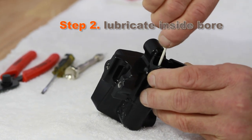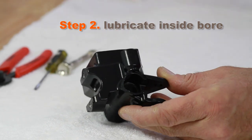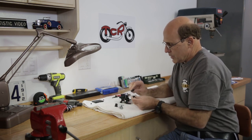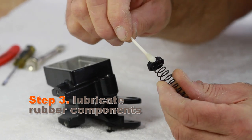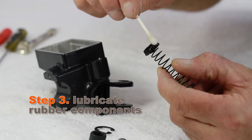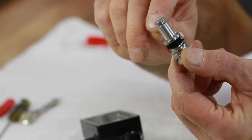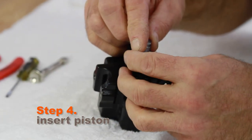So now we come around to the front — take a Q-tip, soak it with some brake fluid, and just lubricate the inside of the bore. You want to do the same with the rubber components that are going to be inside. First, this cup goes on the end of the spring and you want to get some brake fluid on this because it's going to be a pretty tight fit in that bore. Start to get it going — you don't have to push it very far yet. Then take the piston, which already has the rubber seal on it, and get it seated right over that cap or cup.